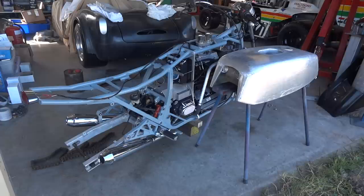And here we go with fire-up number two — this time with oil in the gearbox, and no oil in the engine, but I put oil in the fuel, which should do the job. The reason the fuel tank's sitting over there is because with the fuel tank on, you can't get to the carburetor to adjust the mixture and the idle, which I've already done. So with a bit of luck, it'll run.